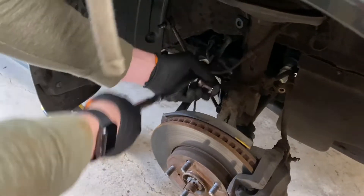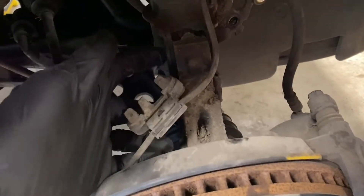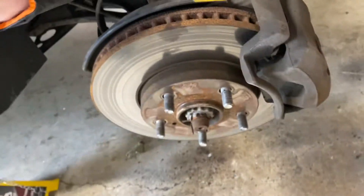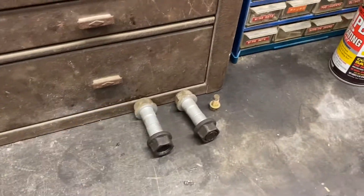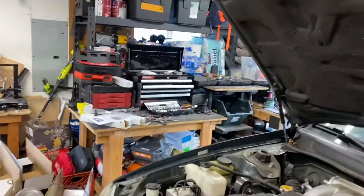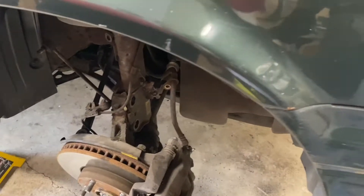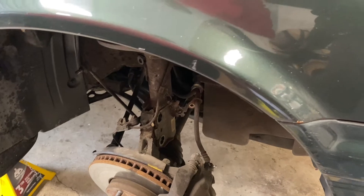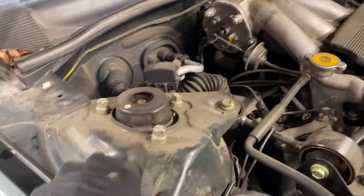Both of those bolts are out — you can see where the missing holes are, the hub is already moving. We used two ratchets hitting each other to pound out the ends of the bolts once the nuts were off and it came off really nicely. Everything's disconnected, so we can take the sway bar end link off the other side. Now we're gonna loosen these top ones — these are 14s up top.